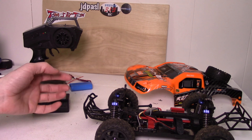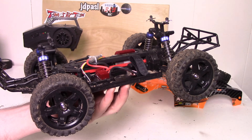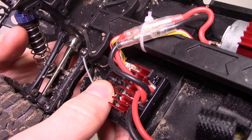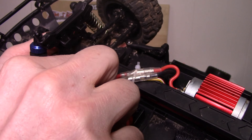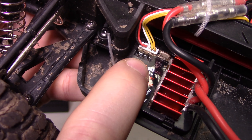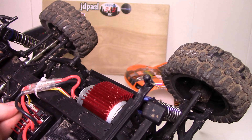Let's get into electronics. There's not too much to it — it's a fairly simple setup. However, with a lot of cheap RCs you usually get pretty junky electronics. One thing I was happy to see is that even though the speed controller uses a five-wire servo, it does have the option, if you remove this adapter, to use a standard three-wire servo. That's very nice to see, and a lot of cheaper vehicles won't offer that.